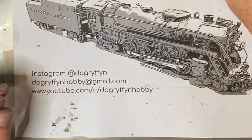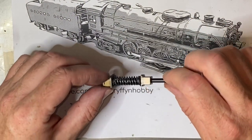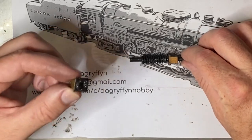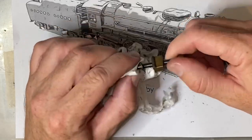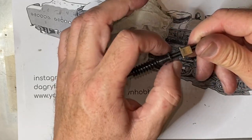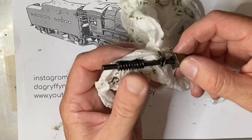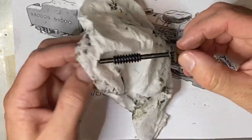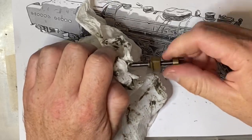Move this out of the way for the moment and I'm going to clean this up. I don't know if it matters which direction these face, but this is the way I got it out. I'm going to try not to mess that up. Now, for the gear, this thick grease that's on here is good, I guess, but it's not really what you want in the bushing. So I'm just going to clean this all up and then get that lubed and reinstalled. And one of those thrust bearings there.